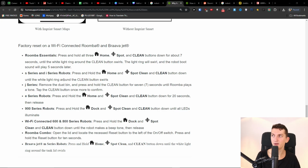In this video, I'm going to share with you how you can reset your iRobot Roomba S9 Plus, and there are two things that you can try. So the first thing that you can try, I'll just read it for you and then we're gonna show it. You want to press and hold the home, spot clean, and clean buttons until the white light ring around the clean button swirls.